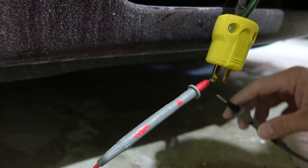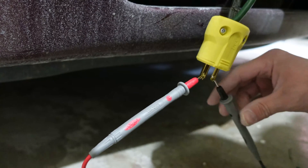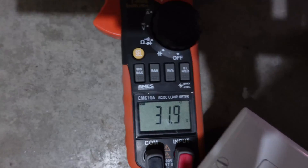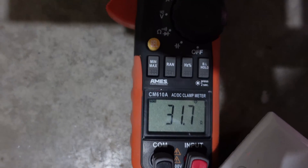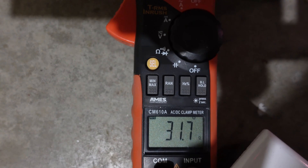Method number two: take and run a wire on either side to either lead and check for resistance. Somewhere between 5 and 40 ohms should be fine. If the value is lower, you may have a shorted-out wire on the end of your plug, or where it plugs into the block.